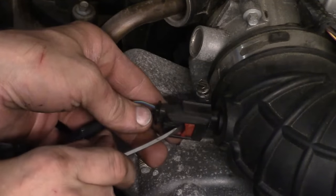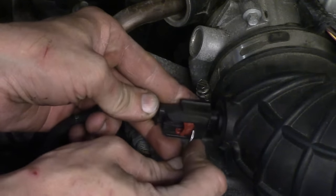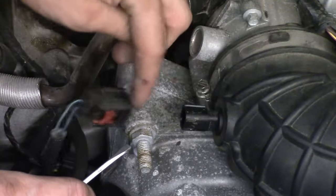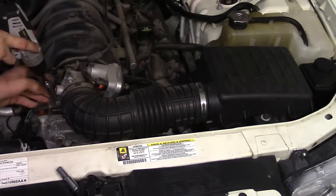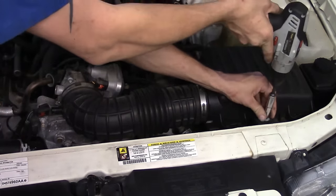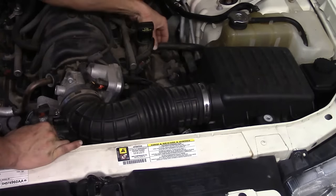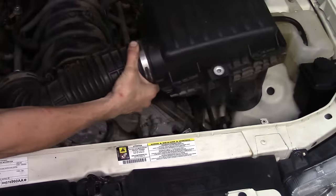The air temp sensor right here has a two-stage lock. There's a red piece you need to slide back — I'm going to grab a small screwdriver to push it back to release it. Now that it's released, I can squeeze in on the end and pull it off. That's your air intake sensor — that's what we have to disconnect to get the boot off. We'll back off the 8-millimeter hose clamp on the rubber boot at the throttle body, then come over to the air box and take the pin off. Now I can wiggle it loose from the throttle body. There's also a rubber hose from the upper lid to the intake that needs to come loose. Now I can just lift straight up and set the whole assembly off to the side.